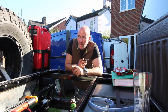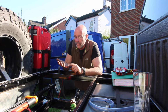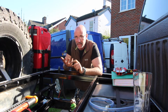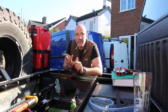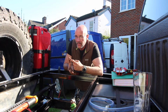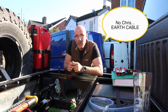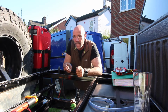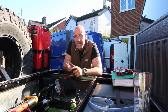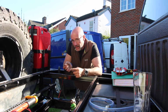We've wired everything in. We had 5 cables coming out of each light, because out of each light you're going to have your fog light on one of them, or your reverse light on one of them. Plus you're going to have the indicator, the tail light stroke number plate light, and your brake light. I've almost forgotten them. So you basically need to work out all your colours, because the 5-core cable we bought, the colours on that aren't necessarily going to match the colours on the lead which came out of the back of the light. So you just need to keep track of what colours are going to connect to what on the original box.